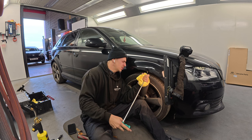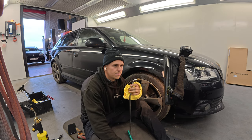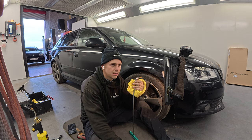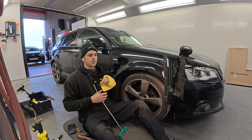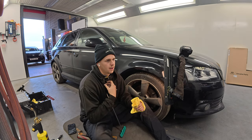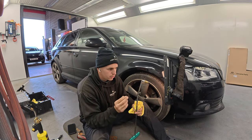There's this strange thing where they'll put a metal tip on and do 90% of the dent with a metal tip, so you end up with a million and one pushes. Why wouldn't you just use a softer tip? They create some work that they need to then tap down. What they do is, because they're only doing small pushes, it puts these sort of micro imperfections in.